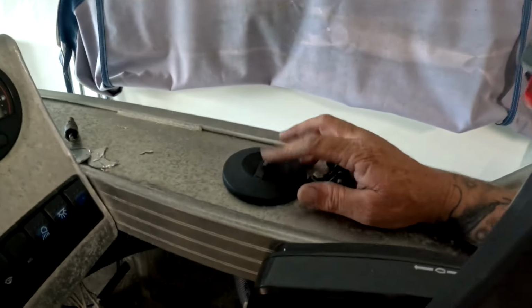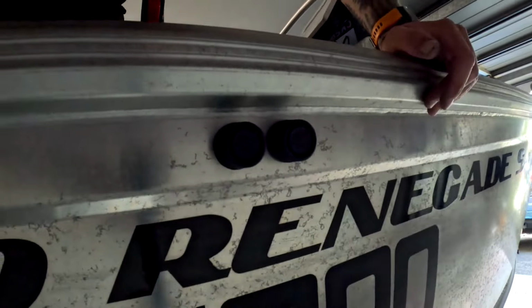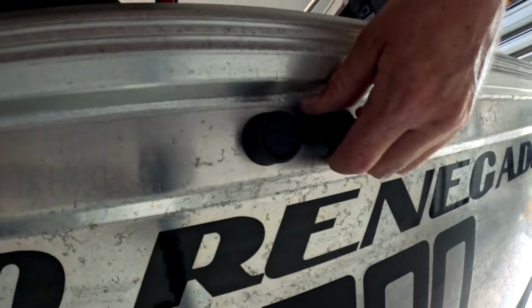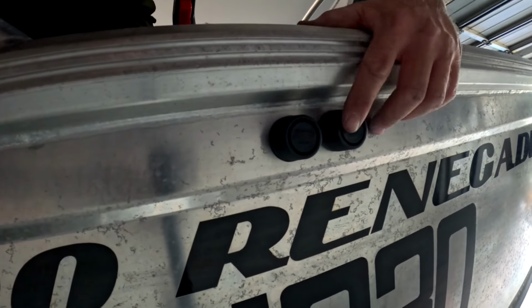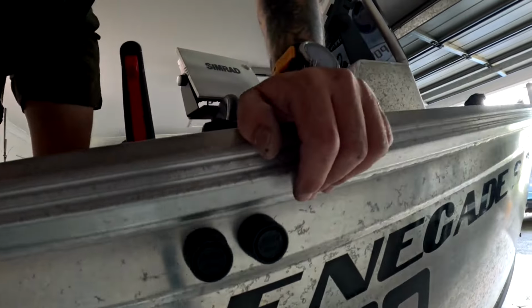And yeah, just again, oval hole through the pocket to fit all your hoses and cable. You'd probably want a 54mm hole for your filler, and probably a 22mm hole for your breathers. I've gone a 25 because that was all I had. Still works fine.